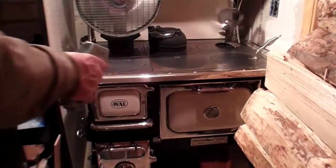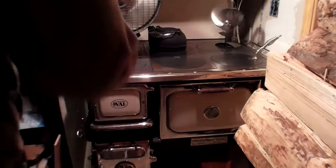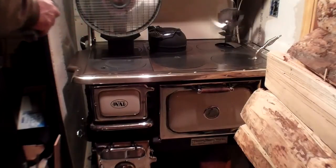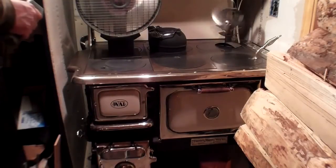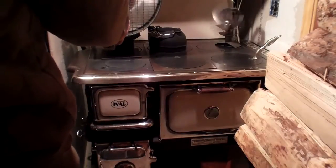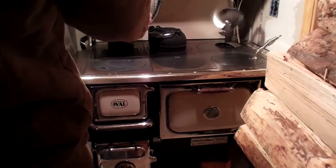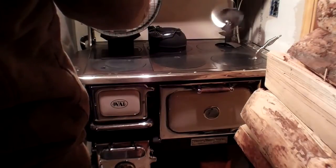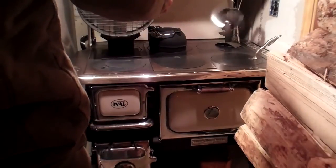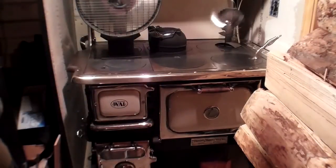The oven door is 120. The oven's been engaged for a while. The first plate is off the chart — above 500. The plate next to the smaller plate is 500 and the frame is running around 450. The next frame drops to 260. Hot plates are 420, rear hot plates are 400, front right hot plates are 300, and the rear hot plate is 366.